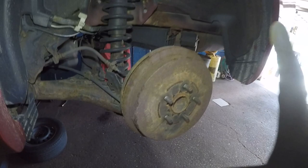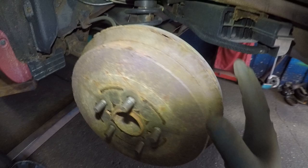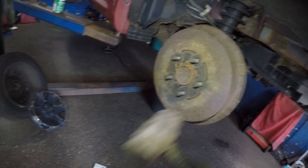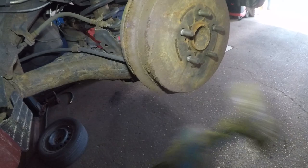If your drums are corroded and making noise over time, they're gonna have rust buildup so they are gonna make noise. What you want to do first — this drum is pretty loose, but if yours is not loose, you want to take a hammer and just hit it softly. You don't want to go crazy. If you're reusing the drum you might want to be careful, but it's always a good idea to replace a drum.